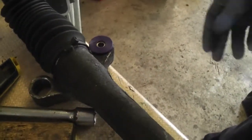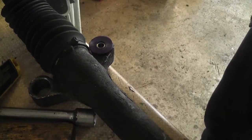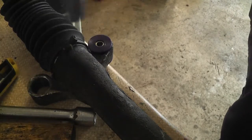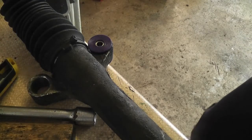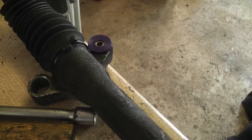Simple as folks — they just push straight in. That's one done out of four. There's no pressing or drilling or anything like that required — it is a handy little job so far. The only thing I had any hassle with was the seized bolts. What I'll do is dress them up with a wire wheel, inspect them, and if they're 8.8 tensile strength bolts I might just replace them because I have some 8.8 bolts here. Let's get the rest done.